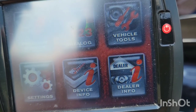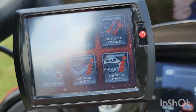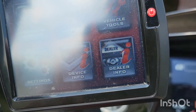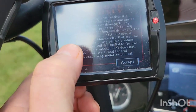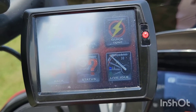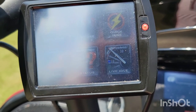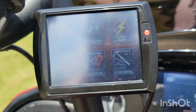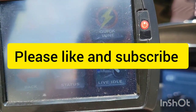Updated the auto-tune I just did, and it runs beautiful. But I'm going to auto-tune off of the auto-tune I just did for a few days to make it super 100%. So I'm gonna do that. So yeah, definitely auto-tune the map they send you, and then you gotta flash the bike after like a half hour of riding, and it runs 100 times better. Awesome. Awesome, Dynojet.